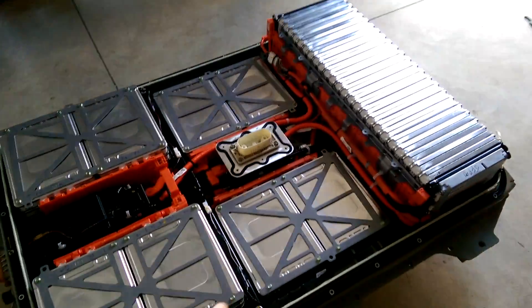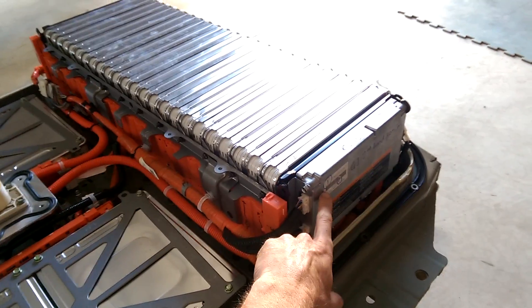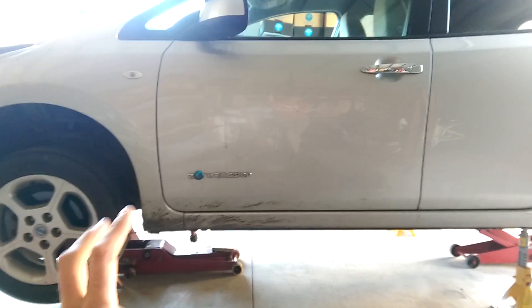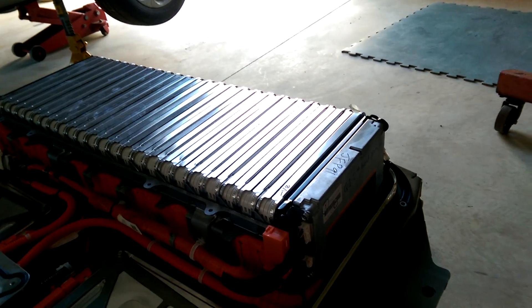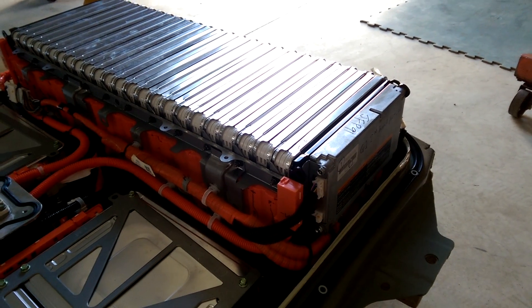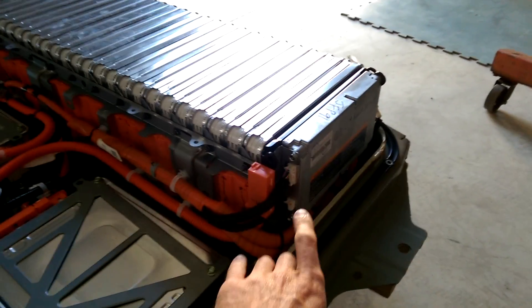The key thing with this job is that you need to maintain your battery management computer. This little guy is coded to talk to the two computers in the Nissan LEAF. And without Nissan's help, you can't reprogram either the car or the battery management computer to talk to each other. So if you don't keep the same battery management computer, the car will not work. I think it will let you run at 25 miles an hour or something, but it won't do any more than that. So that battery management computer is gold.